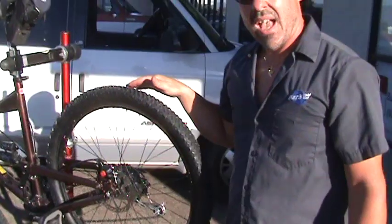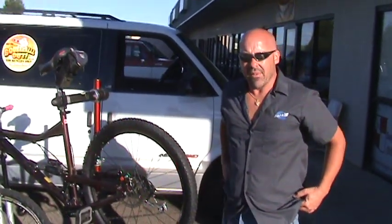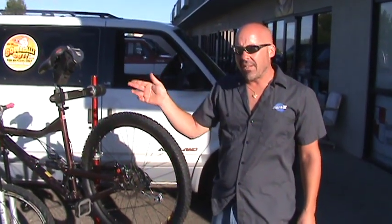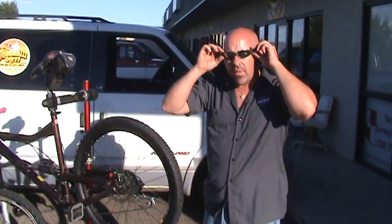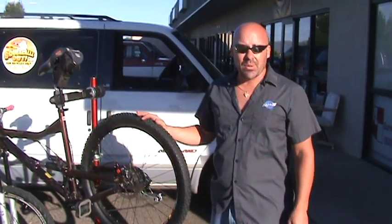Now that all that's cleaned off, what I would do with this bike is ride it in the parking lot — a safe level environment where you don't have any obstacles. You still have a functioning front brake with all the power. I'll drag the brakes for about five minutes sometimes before I'll get most all that braking power back. You want to make sure that you get all your braking power back before you ride the bike with the rest of them. That's all there is to it.